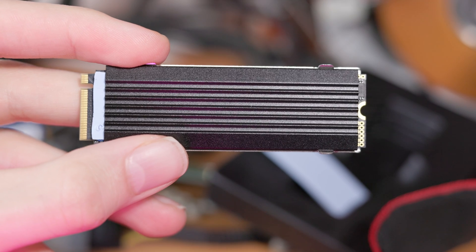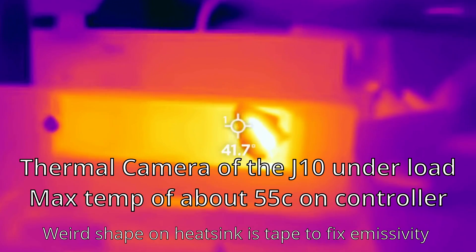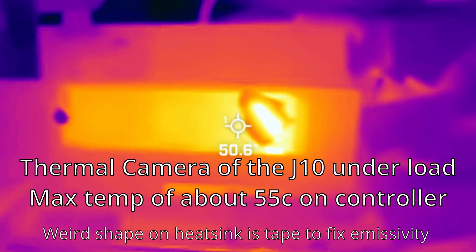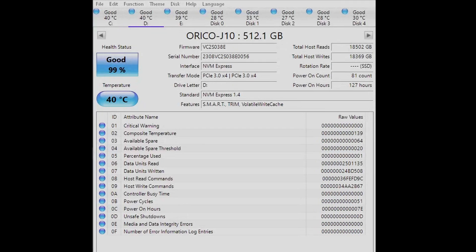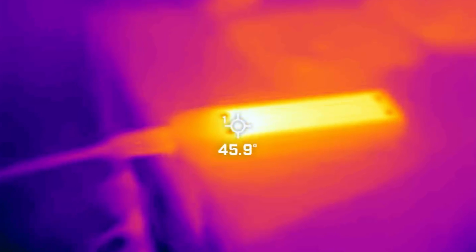Now let's take a look at the thermal performance of the J10 SSD and the enclosure. The J10 comes with its own NVMe M.2 heatsink, but it can't be used inside the enclosure — only on a separate motherboard. Being a fairly low-end SSD, the heatsink really isn't needed as it doesn't pull much power. I didn't see temperatures get to an unacceptable range on an open-air test bench. However, the temperature sensor seems to have a bug, as it always reported exactly 40°C across multiple systems and OSes. Inside the enclosure, I saw roughly 47°C on the external heatsink using a thermal camera, with no noticeable thermal throttling. It was very warm to the touch, but not hot.